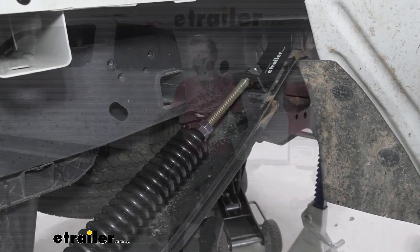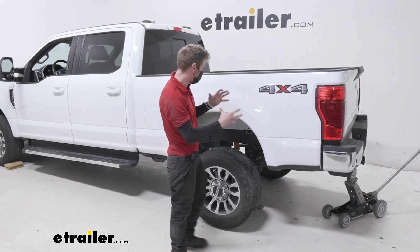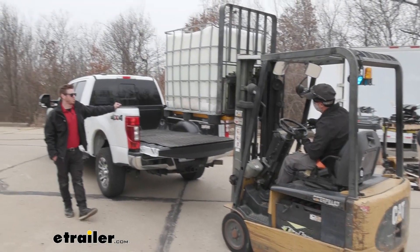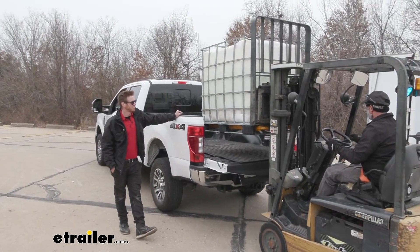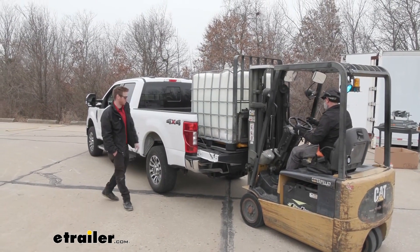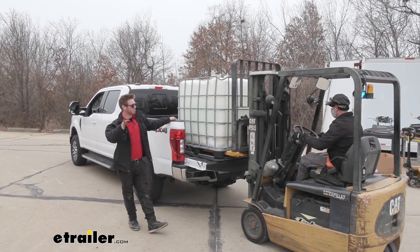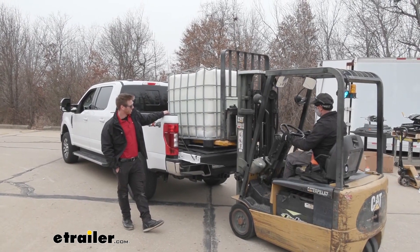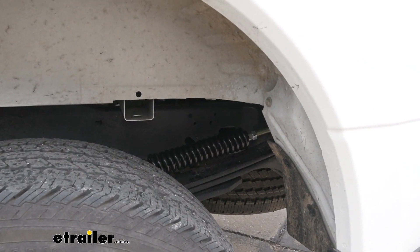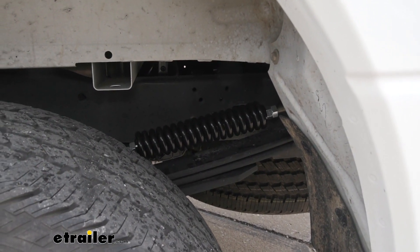It really wasn't that difficult at all — it's the same exact process on the other side. Once it's all installed, everything's tight and adjusted and locked into place, go ahead and lower your truck back down. I called my buddy Joe and he's going to put some weight in the back of the truck — this is about 1,500 pounds give or take, so it's quite the load. Oh wow, I can already see the spring working, so it's going to be very interesting on our test course. Right as he lowers it down, that spring is definitely working — less load on my leaf springs, that's what we're really going for here.